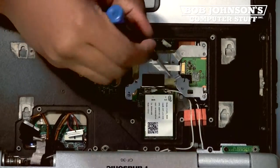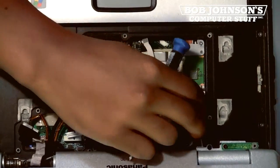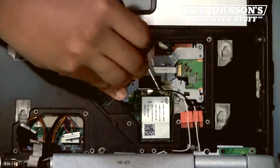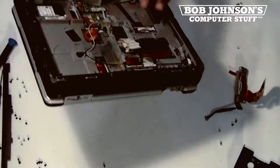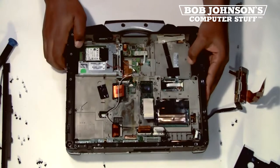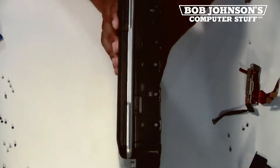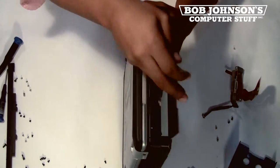Let's quickly go to the top of our Panasonic Toughbook CF-30. Underneath the keyboard cable cover, if you see a Bluetooth ribbon cable or antenna cable still connected, please disconnect those cables now. Be sure to also double check your peripherals and make sure that nothing is in these slots, such as dummy cards.